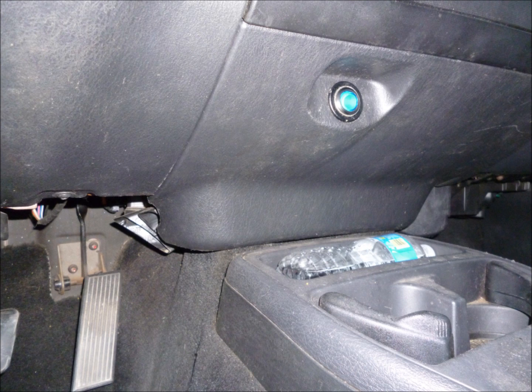Back to the inside of the car, and you want to pull that red wire through that we pushed through from the engine side, and route that over to the center of the vehicle. And you want to be careful that you don't have any wires drooping or binding with the steering wheel or something that'll get caught in the accelerator, etc. So use zip ties and bring that wire over.